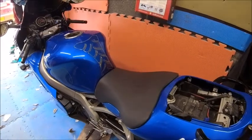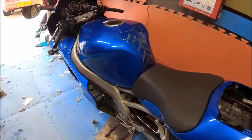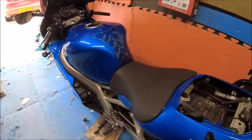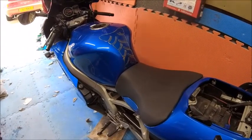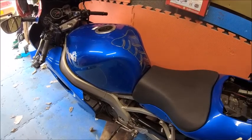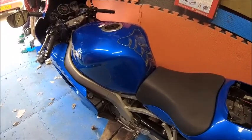Hello Internet! A couple of little drops on the Ninja today. I had the tank off yesterday and gave the carbs a good clean out - it's not been used for a while. The fuel pipe was also a bit rotten so I replaced that. Went for a ride yesterday and down low it's really hesitating, not running right. So today we'll have a look at the state of the plugs. I've got some new ones on order but I'm going to look for the blatantly obvious. It was alright over 3000 revs but anything below that it really wasn't happy - so going through towns, villages, speed limits, didn't like it at all. Let's dive in!